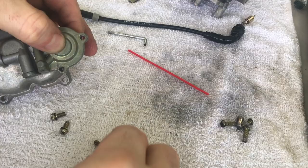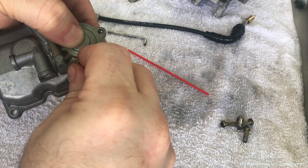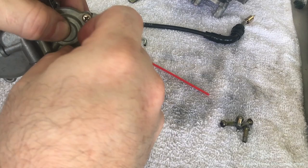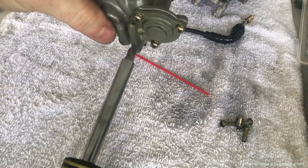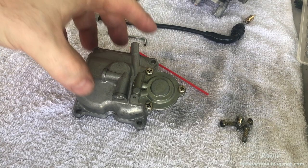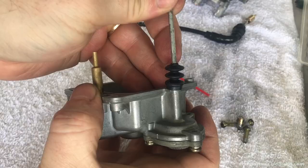You can actually separate it apart to have a look and make sure everything is seated nicely before finally closing everything, holding it with your finger while introducing the screws to tighten it down. If you accidentally let go before it's fully tightened, you'll have to reopen it and make sure nothing shifted out of alignment. All three screws are then gently snugged down with the screwdriver. I then insert the accelerator pump linkage just to test the mechanics — looks good.